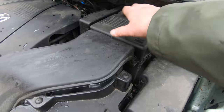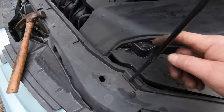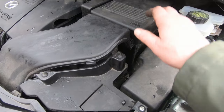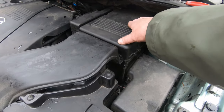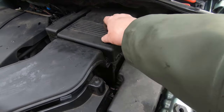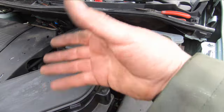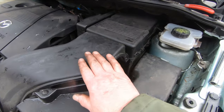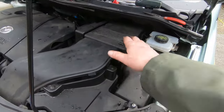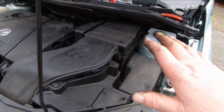I've got the covers on. This is a little air shroud — it's a bit of a scoop that takes air in here to dissipate any of the gases that are generated when the battery is charging. Batteries produce a combustible gas when charging, so you want to make sure that gets circulated. That's why manufacturers put this little air shroud in on this particular model. Every manufacturer is going to be a little different, but if you have these covers, make sure you put them back on properly — they're there for a reason.